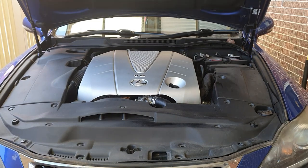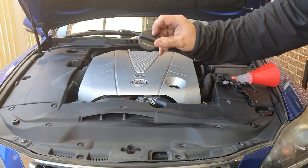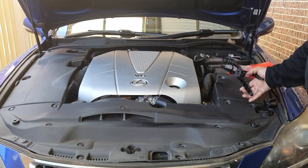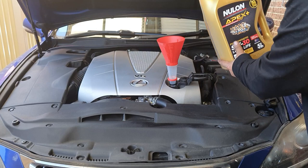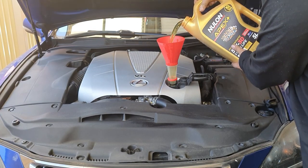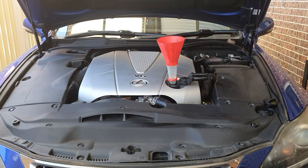We need to put in a little bit more oil. I'm going to add one more liter and that should do it. You can even see on the cap it also shows 5W30, confirming the viscosity you should use. I'll stop pouring at about four liters on the bottle since it's a five-liter container — we're on level ground and it's still just above four.